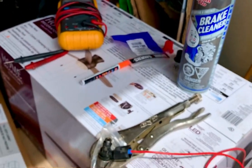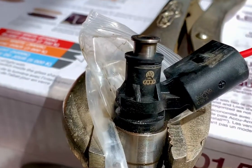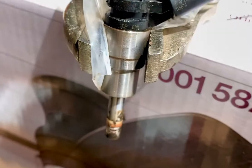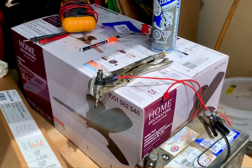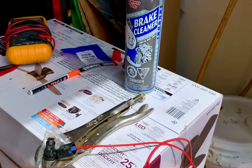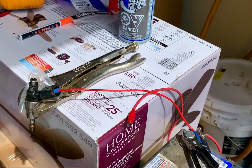Sure enough, I found the one that's dribbling out. I'll probably use this one even though I got a bit rough with it and marred up the edges a little, but I know it was a good injector — it's not the number four that was bad before. I'll clean up all the carbon on the bottom. I got this idea from someone else so I'll post their link in the description. Thanks very much for making that video — these videos really help.